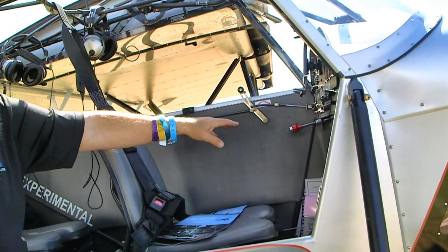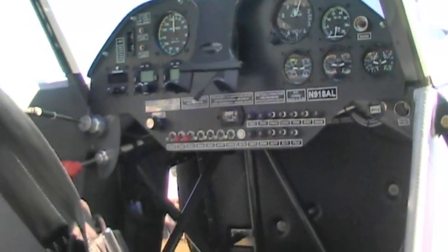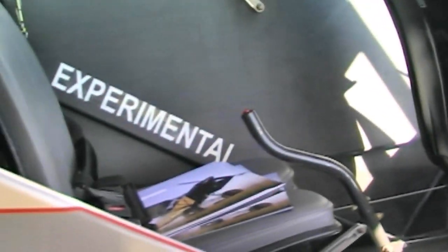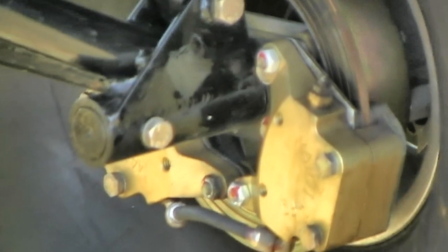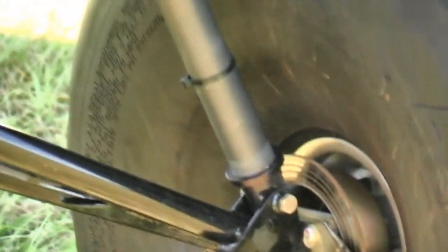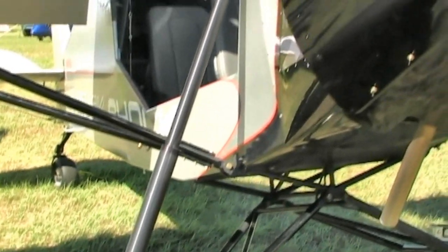on Rotax aircraft because they don't use mixture control. So when you're turning off a Rotax, you just turn off the ignition. You shut off the electrics to the engine and it shuts off. In the case of this Titan, it uses a mixture control. That's what the big knob was, to shut down the engine. The mixture control is a vernier control that you can finely adjust, or you push in on the button and pull back, starve the engine of gasoline and it shuts off.